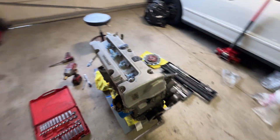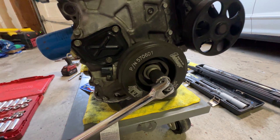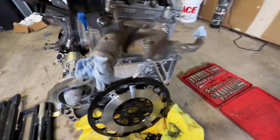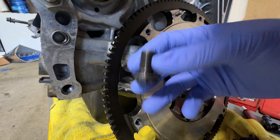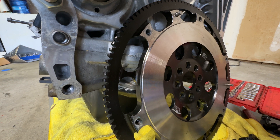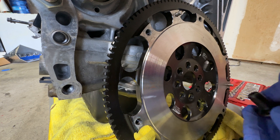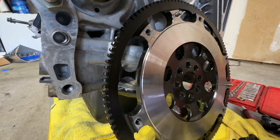Here's a little trick: if you have your motor set up on a cart like I do, put your breaker bar on the crank pulley side so that when you tighten the bolts on the other side it won't rotate — because you do not want your K series to rotate counterclockwise. Now to get a correct torque reading, I put a tiny bit of ARP lubricant on the head of the bolt underneath the lip, which helps lube it up so that friction doesn't give you an incorrect torque reading.